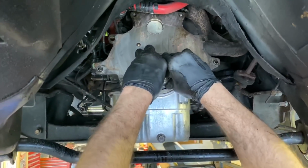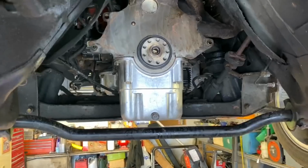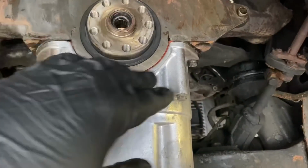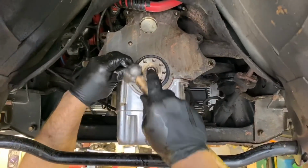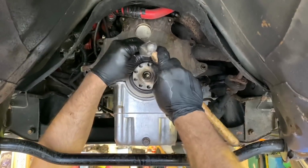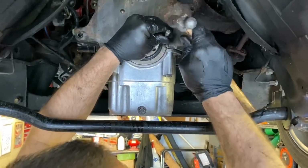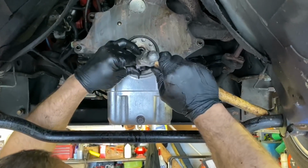So he's just pushed it on whilst it's on the plastic bit. And then it slides straight off. And just knock it and then it stops it rolling back on itself. So then that's all going to be in and sealed. He's going to just tap that in and that'll all seat up nicely, as it should do, and you shouldn't have no more leaks. A lot of people pull them straight off of that bit of plastic, and that's where they get problems, because it rolls back on itself and it won't seal properly. So you're just going to tap that home, and then that's that in correctly.